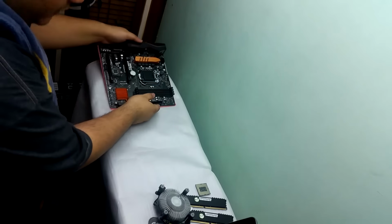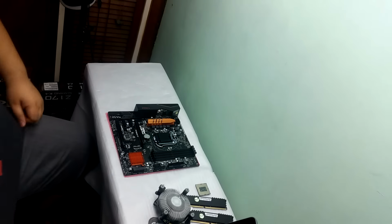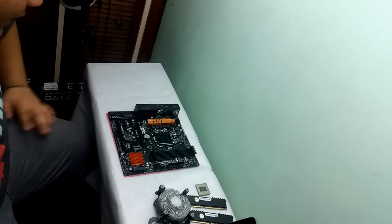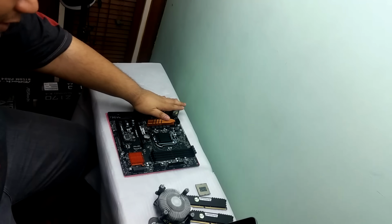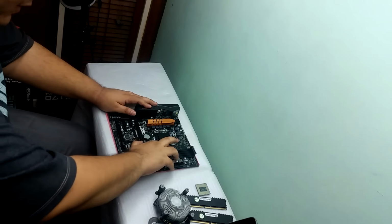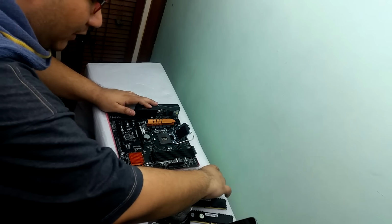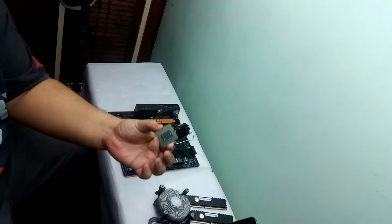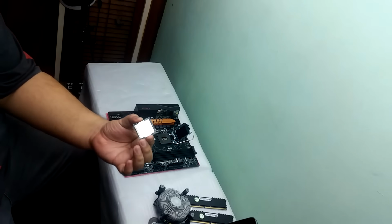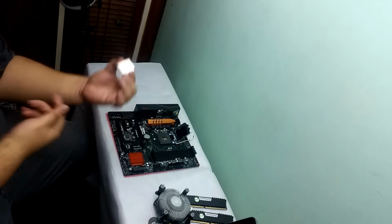Okay, here's the new motherboard. First thing we want to do is put in the new CPU, because it's going to be the centerpiece, and you want to get the centerpiece done first. All right, so just like before, push in the lever, pull it out of the little notch, and it'll open like so. Get your CPU, don't touch the pins in the middle. Now, I'm very used to where the corners go, but normally the writing on the CPU is facing you when the motherboard is facing you.